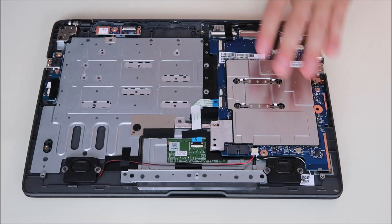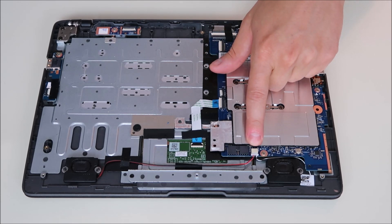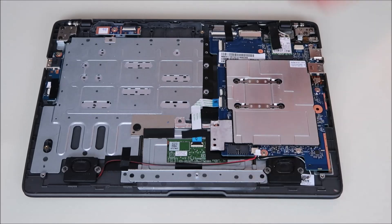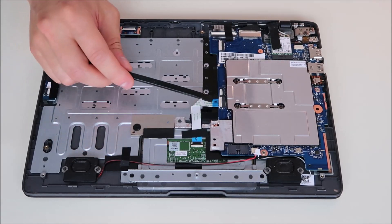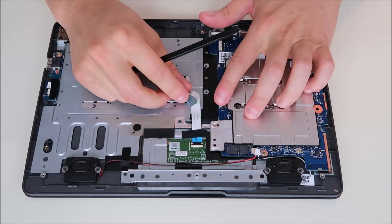The motherboard is located right here. A lot more things are plugging into it than just your battery, so we'll go step by step. Right down here, your speaker wires are coming into a port. It's a very typical connector — it's got two little lips on either side — so we're going to put a fingernail in one, pry it to the other, and slide that right out. Speaker wires unplugged. You come around here and there's another ribbon cable coming from your touchpad. I'm going to pop that up just like we did on the battery, slide that out, and put it back down for safety.